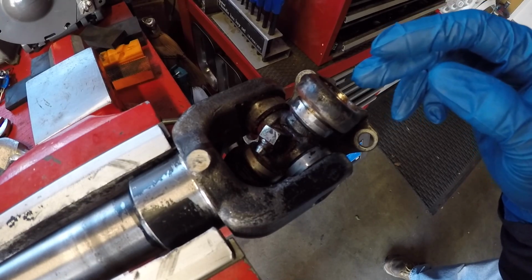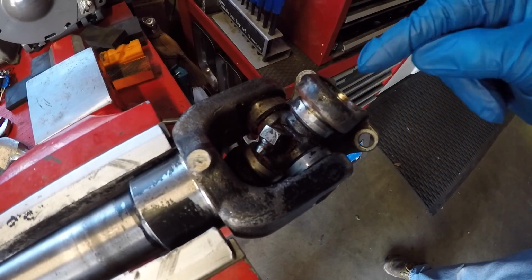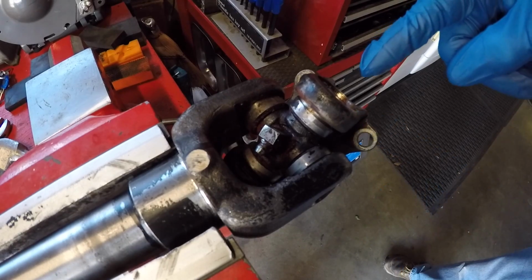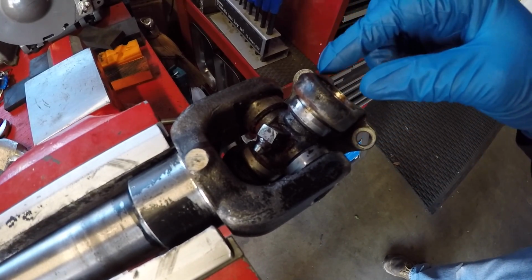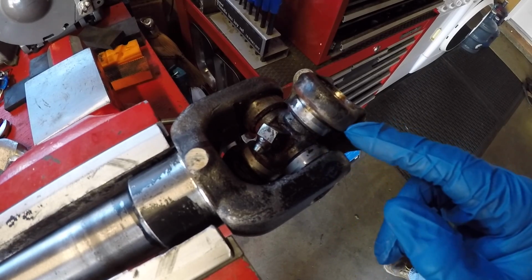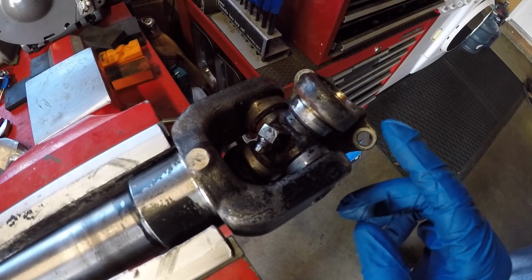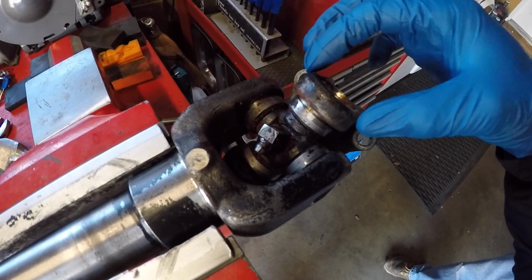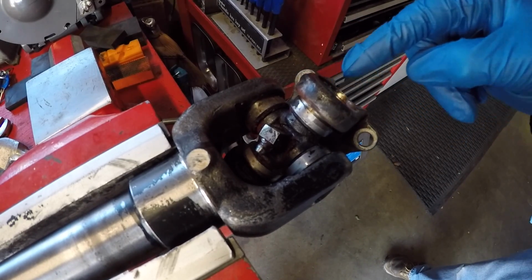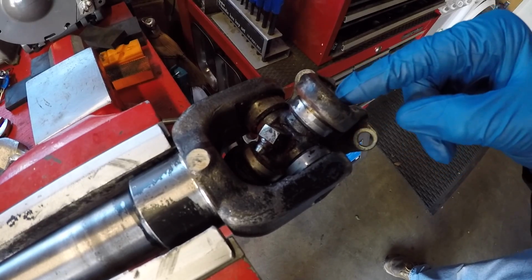What Jordan and I learned the first time is that you have to be careful how far you drive the bearing cups. Each bearing cup has to come out its respective side. You can't just drive all the way on one side, get the cup out on the opposite side, and then get this cup out this side. They each have to come out their own end. When we're driving on this side to get the opposite bearing cup out, you could end up driving too far. Basically, the end of the bearing cup will come unhooked from the yoke. And the problem that gives you is that now you have to realign this cup in order for it to be driven out this way. And that caused us a lot of grief because we at first couldn't get it driving out square, and it started scoring up the inner diameter of the yoke and took a little bit of metal off. We're going to be really careful of how far we first drive this direction to where we get the other cup exposed, but we don't fully push this bearing cup out the other side.